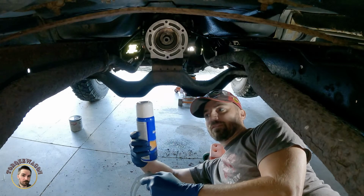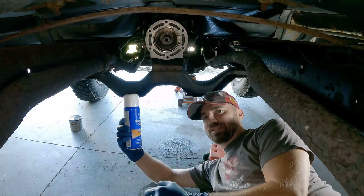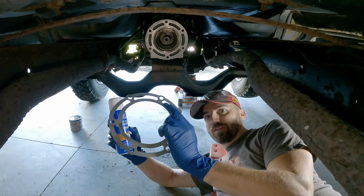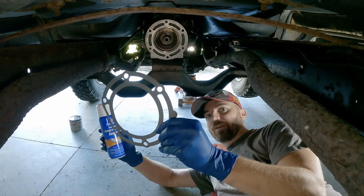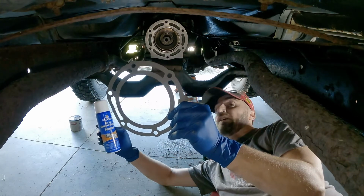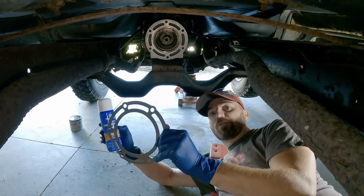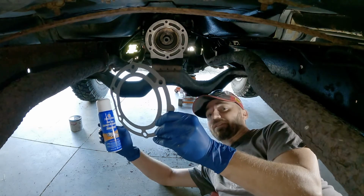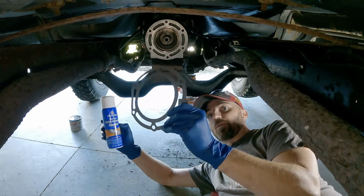So I'm using some Permatex high-tack spray gasket sealant, that's hard to say, to just tack this up while I put the transfer case on. This gasket, by the way, only goes on one way. The holes line up a certain way. I've already done a test fit once or twice. I honestly don't know if there's a particular side that has to go towards the transmission and a side that has to go towards the transfer case. I will put a link in the description for this particular gasket.